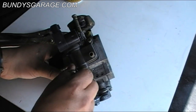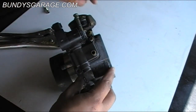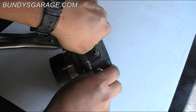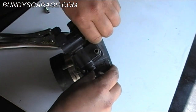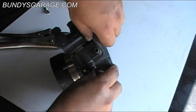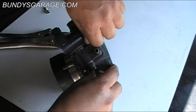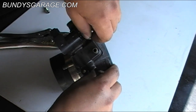The reason I didn't want to do this on the car is actually because I didn't have enough room to get the vice grips on there, but also I didn't want to damage any of the other sensors — especially the throttle position sensor. It is possible to change it even though there are break-off bolts on it; it's kind of a hassle, but you can do it.